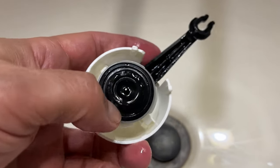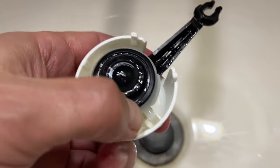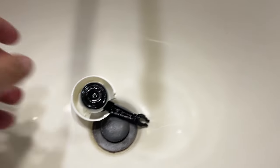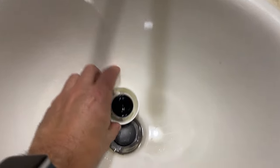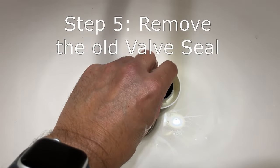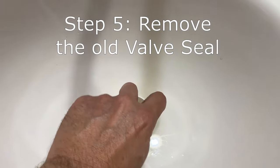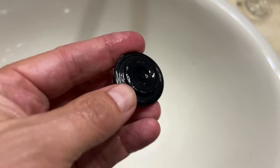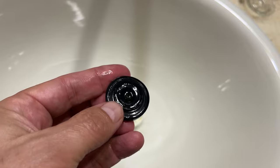This one is a little warped, so this is what's obviously causing the whistling. The water gets caught in there and makes all kinds of fun noises. The gasket is easily removed just by pulling up on it. There's a pin in the middle, so be careful not to poke yourself. You can see from this one, again, it's warped.